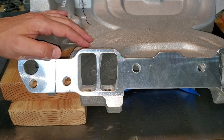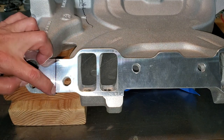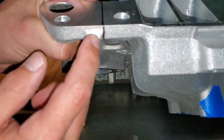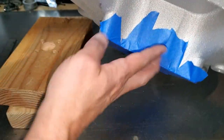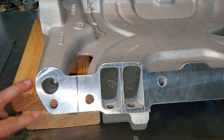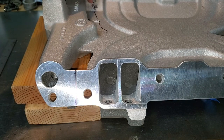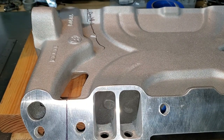Change of plans — I'm going to use my bandsaw. I made a 90-degree line which matches up with the nodule on the other side, so it's straight across. The challenge was that this is at an angle, but two-by-fours happen to be the perfect height for making a 90-degree cut. I'm going to do both sides and then go down the middle.